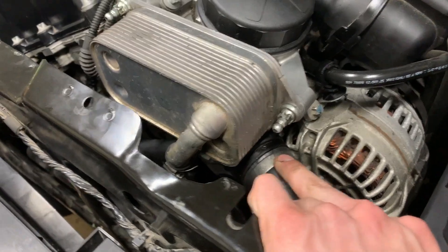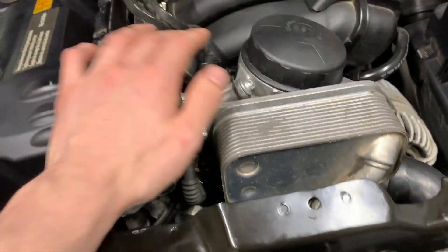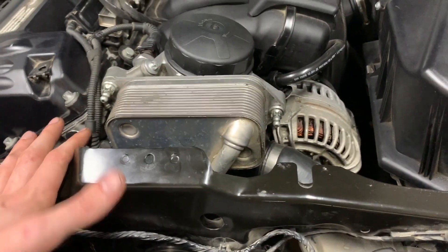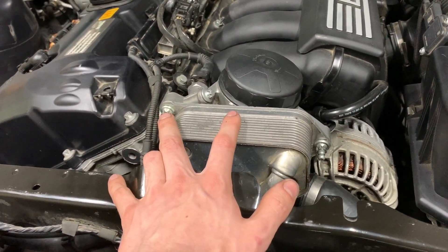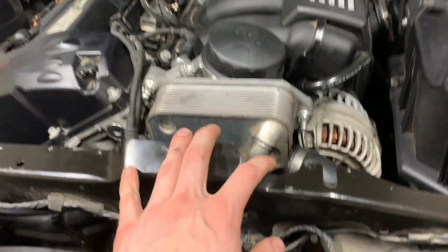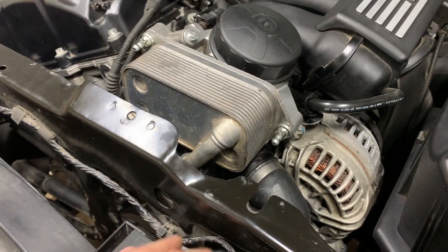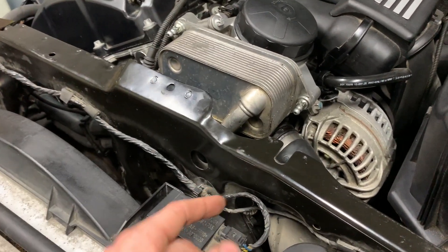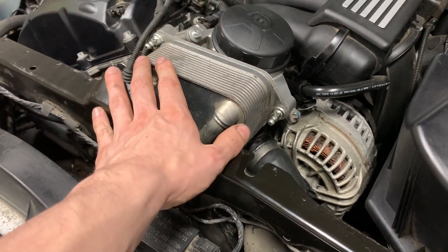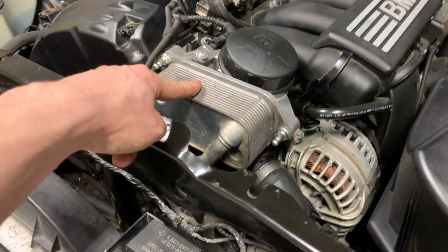You also need to remove this hose — don't forget to take that off. Cleaning up isn't too difficult but make sure you have a ton of towels as it drips oil everywhere. I recommend removing your belt — I haven't replaced mine yet but I'll do that shortly — so you don't get oil and coolant on the belt and pulleys. Make sure you clean the pulleys afterwards.